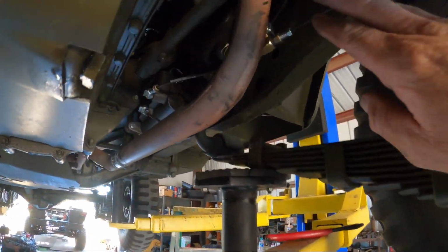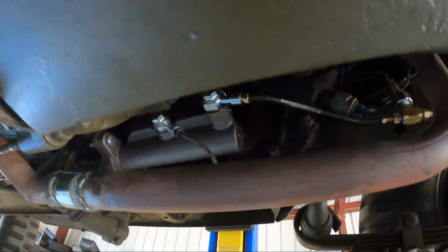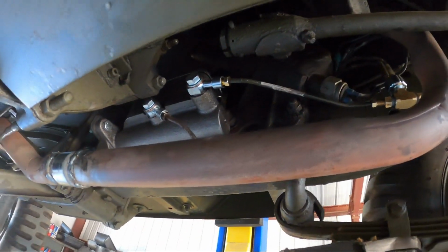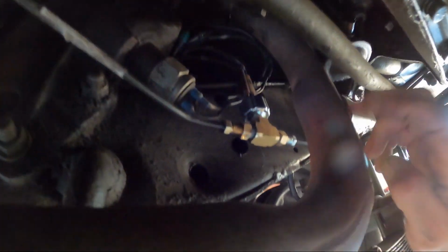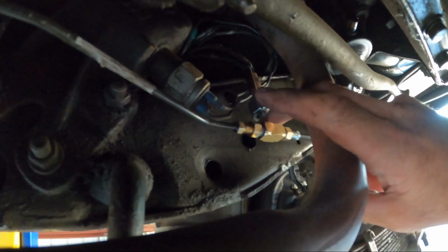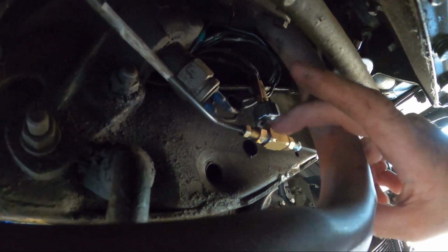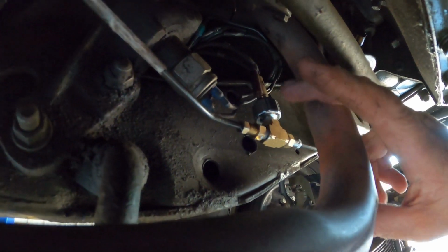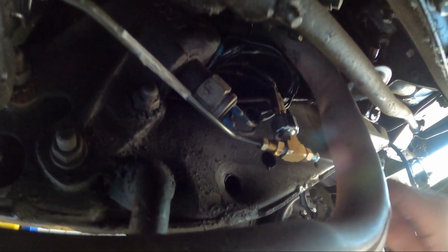Okay, so I finally got it done. It took 2 auto parts stores, an off-road shop, and Lowe's to get enough parts to do just what I did here, to put this T in. The T I bought at Napa, I thought it was a male pipe thread here. It had the 3/16, and it looks like I got to tighten it up a little bit, a little drip there. But it wasn't. It was some odd metric thread or something.